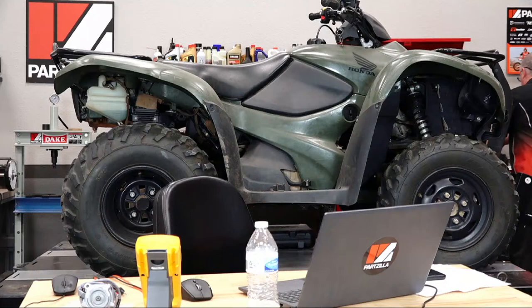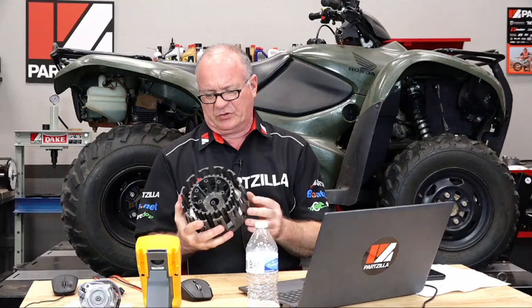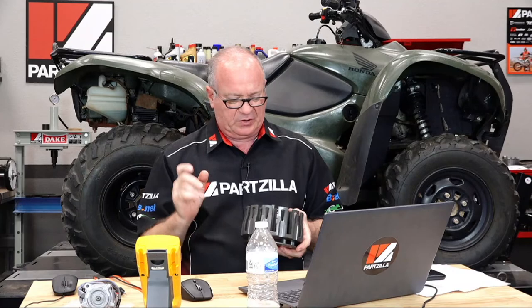Yeah, it sounds like it's overworking the clutch, and I know they had one for the 2016 because we're going to be doing that on ours. Check Yamaha's website, as they have a GYTR version. This is for the 16, of course. But if you're increasing that much power, it may need a little bit more clamping force in there. This one's a little bit more robust around the basket itself, and the springs are a little bit tighter, and it'll be able to handle the additional power that we're going to put in this one. Odds are that Yamaha has one for yours as well. If they don't, let me know, and we'll point you in the direction to get you some more clamping force, because it sounds like that's what you need.